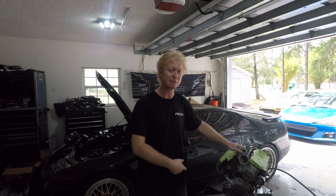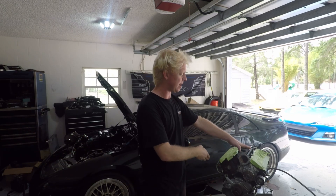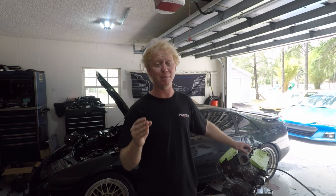Alright, welcome back to the channel. Today is D-day for the VG30 — we are going to be fully assembling this motor. We have built heads with JWT 500 cams, ported intake and exhaust ports. We're mounting those heads onto the bottom end, cleaning up and prepping all surfaces, then throwing on the timing belt as well as billet valve covers from Merlin Machining.